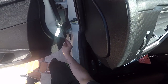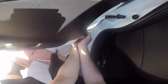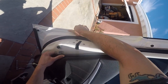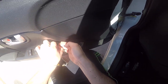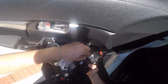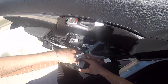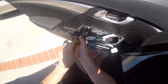Popping the door panel is pretty easy. There's a little groove right here where you can stick your fingers in — just give it a nice little tug. The door should pop out. There's also this piece we need to remove — stick your fingers in there, give it a nice pull, pop it right up. You do need a screwdriver again. There's a connector — just unplug it. And there are two screws to remove.